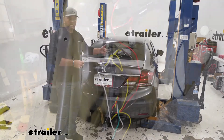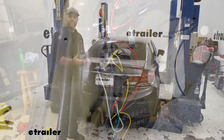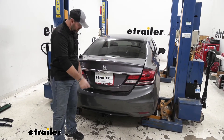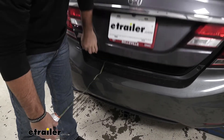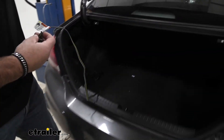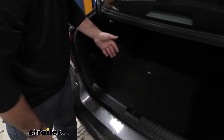Installation is going to be very simple. It's going to plug directly into factory wiring behind each tail light. One thing you're going to do is ground your wire. It's going to live inside the vehicle, so when we're using it, you simply put it over top of this rubber seal here, stay away from where the trunk attaches, and you're going to close your trunk and hook it up to your trailer. When you're not using it, you're going to simply roll it up and store it with your spare tire so that it's nice and safe.